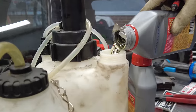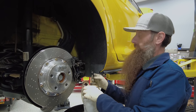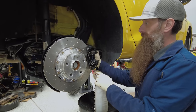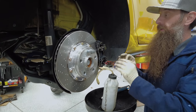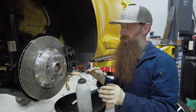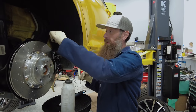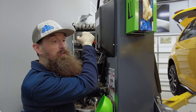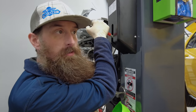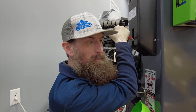We're going full race car this time. When it comes to flushing brakes, sometimes the order really does matter for some cars, but most of the time it doesn't because all you're doing is exchanging fluid. Bleeding brakes is different — with bleeding, the order is vital because you're trying to get air out of the system. If you don't do it in the right order you can leave air behind, especially with ABS bleeds. Everything's done, fluid is flushed, wheels are on — we have to torque down our wheels and then drive it to do the brake pad bed-in procedure.